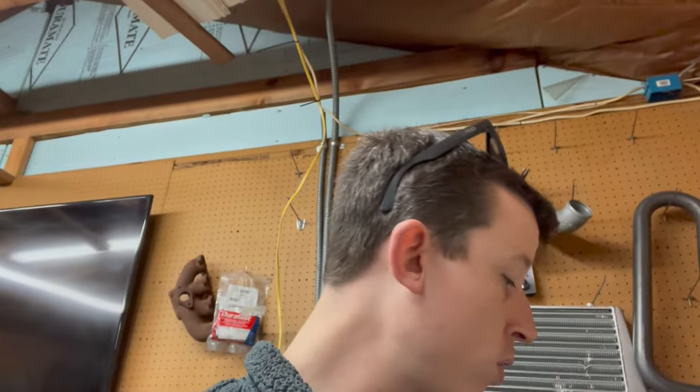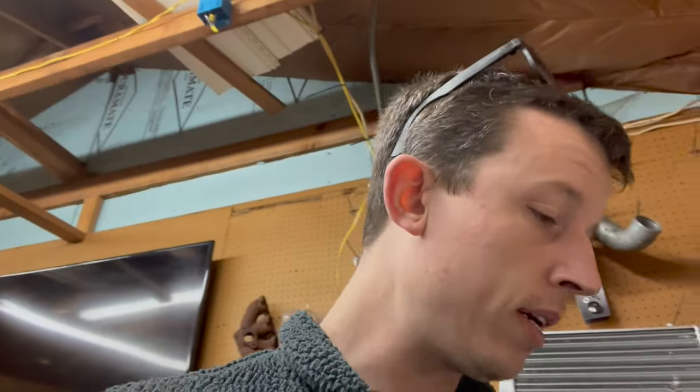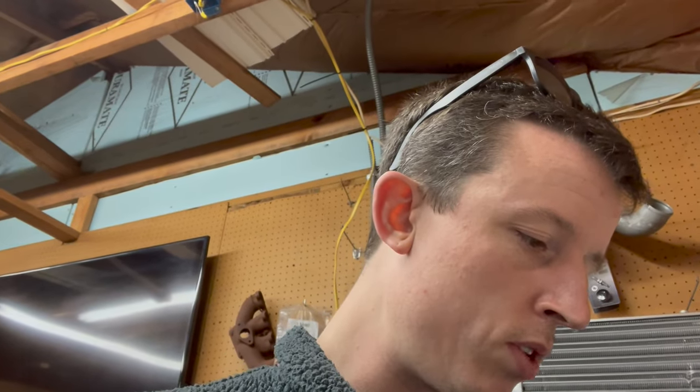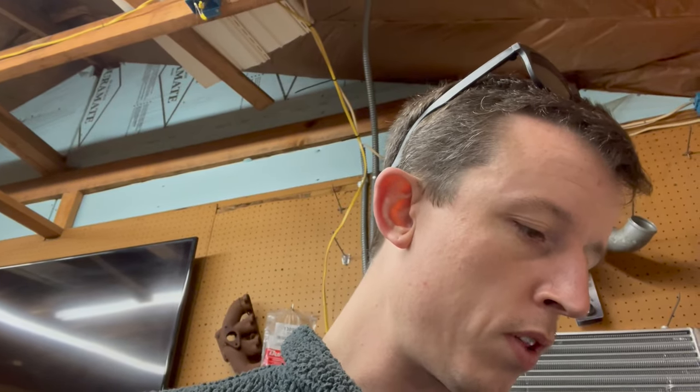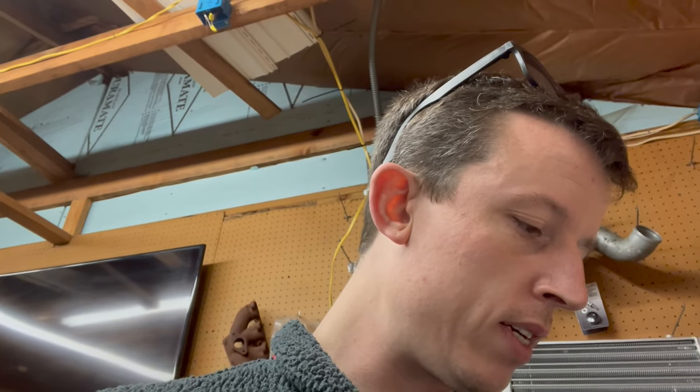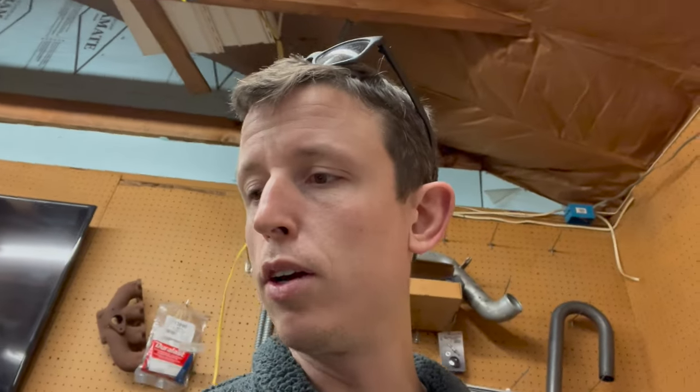So guys, our next step is to mix half of our quart along with hardener and then pour it in. Chris mentions to pour epoxy into the jacket. I prefer to use a small funnel. The epoxy will rest. You want to build it up in flat stages. So we're going to pour a little bit, then a little bit, then a little bit, is kind of how we're going to do it. So we're going to mix some epoxy. Let's get to it.